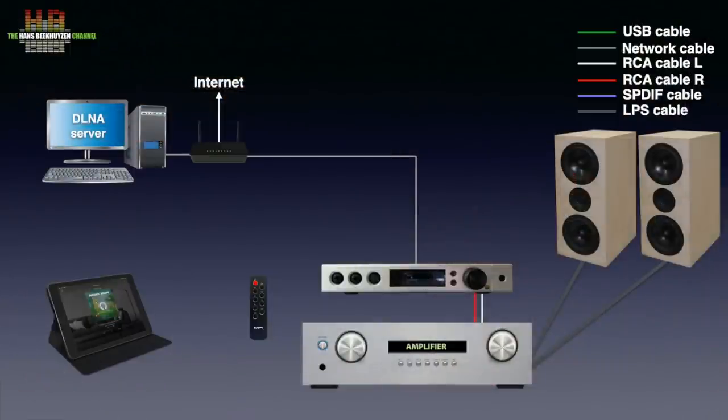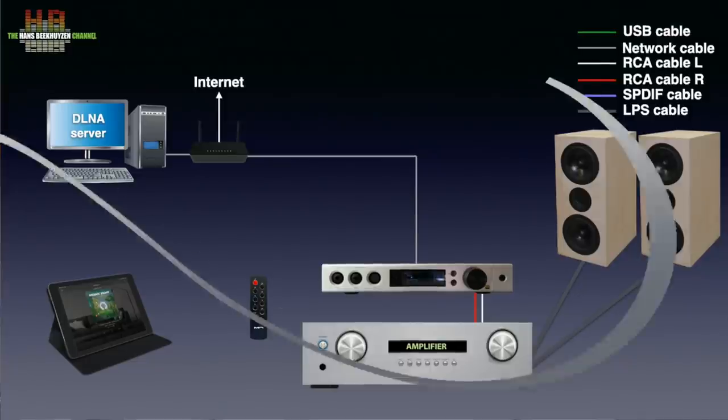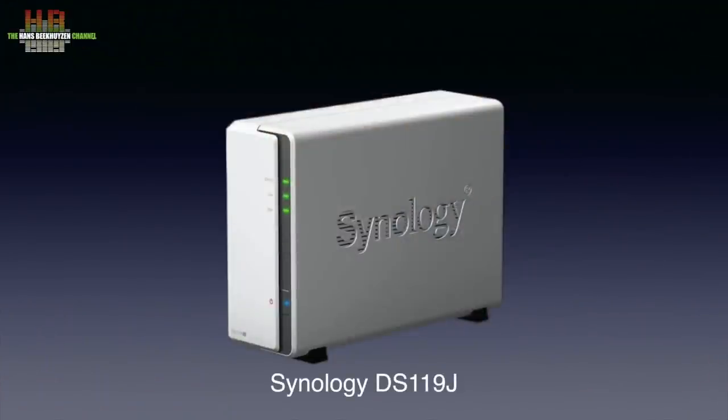Let's take a look at DLNA. You need to have a DLNA server running on a computer or NAS — there are countless DLNA server programs available for Windows, Mac OS, Linux and NASes, many of them free. I use Minim Server, which for basic use is free. In contrast to many DLNA servers, Minim Server only does audio and therefore works with more audio-specific metadata fields. I have Minim Server running on the slowest, simplest Synology NAS — the DS119J — that holds an 8TB drive, which during testing was also synchronizing with my music from another computer.